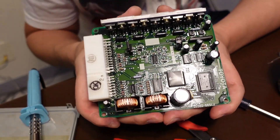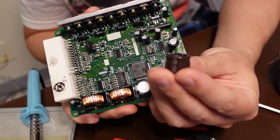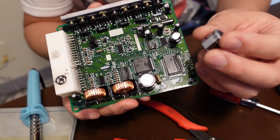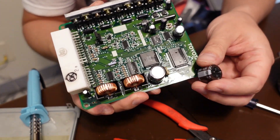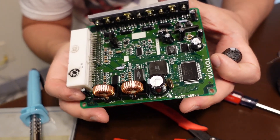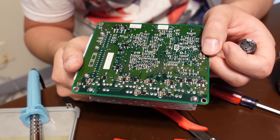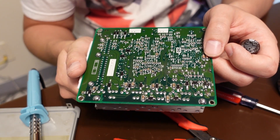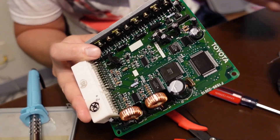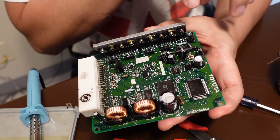Following day — I think I got everything done. I wound up snipping one side of a capacitor leg off, then heating up and pulling the capacitor out. I do not have the desoldering tools that I normally have — I just have a soldering iron I had to pick up from a local hardware store. It was a little bit difficult just because it's such a small space. Just be careful to hold solder joints, make sure everything's connected properly. I tested this on the car, so it looks like it's working. I'm going to recheck some of my connections, but this should be good to go. All in all, it was seven capacitors: one here, one there, four in a series, and then these two guys here.